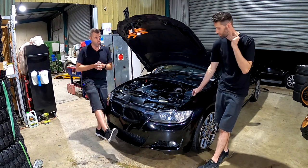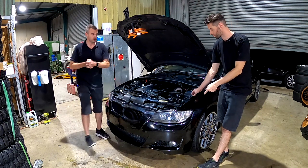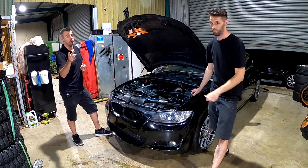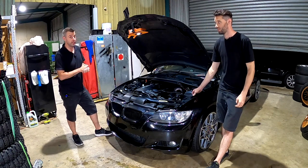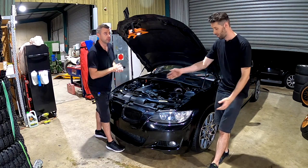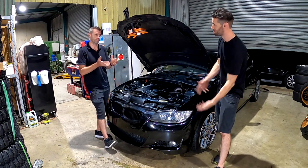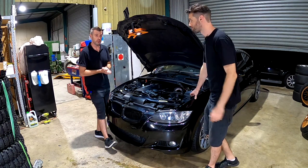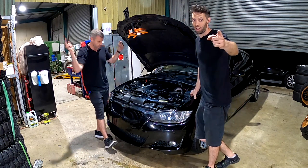One other thing I just remembered about fitting the oil cooler — don't forget to check the transmission fluid level after it's fitted. We added nearly over a litre of fluid to fill it up properly, and you actually filled the trans cooler itself before it's bolted in as well. Don't take any shortcuts — check the level. I think that's about it. Alright guys, thank you very much for watching, see you on the next one.